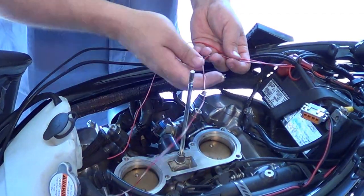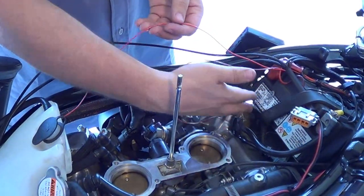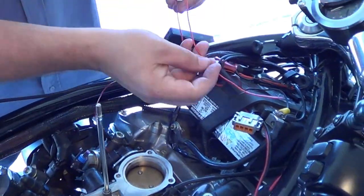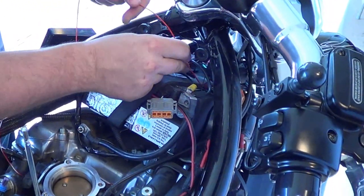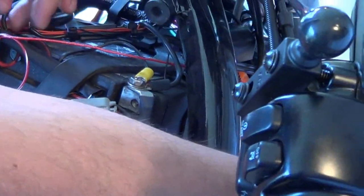I'm going to leave these two red wires hanging and we'll lay the rest out here. The red and white wire is your battery wire, your hot wire — we're just going to lay that down on the bottom. The solid red wire is your data link connector wire; we're going to feed that through the other side of the bike and hang it out alongside.